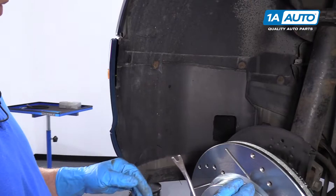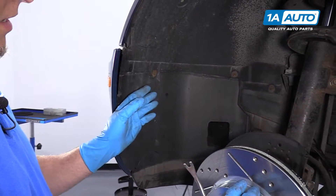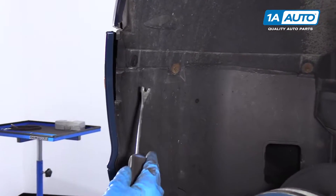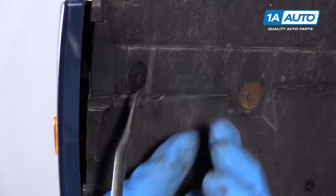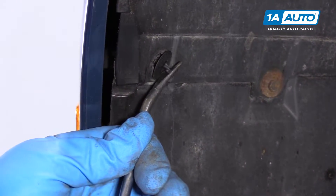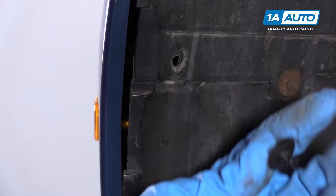For the sake of the video, we took the wheel off. You don't have to take the wheel off to remove the bumper, but it's easier to show in the video. You could just turn the wheel to the side to access these bolts. The next part we're going to do is take this clip off right here. I'll use a clip removal tool, pull the center part out a little bit, and the clip will come out.